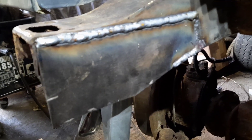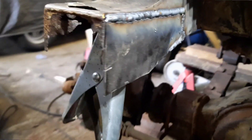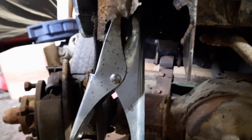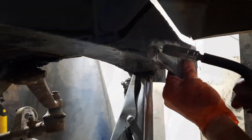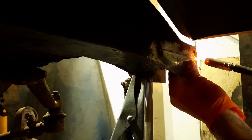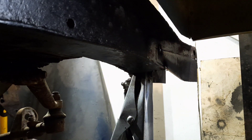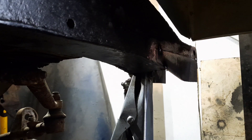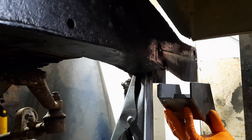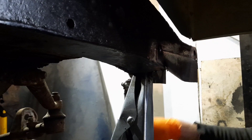That one side repair panel — seam welded in — I think that's nice and solid. Looking at doing this side next — tap that into place. Someone wants to just tap it in a little bit so that that spring hanger can go over the outside.